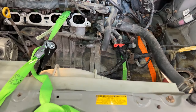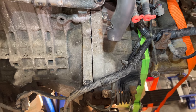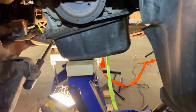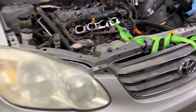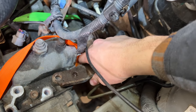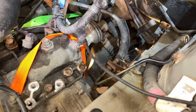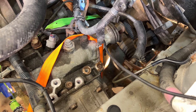The engine and transmission are starting to split. I left one bolt at the top while getting them apart, but they felt basically glued together. The only place I could manage to get a crowbar in was right at the tip there. Also, I realized a bracket was going to be in the way as we lower things, so I went to remove it and of course one of the bolts broke. Just use a torch and impact tools basically everywhere to loosen these bolts if you've got rust because they're just snapping left and right.